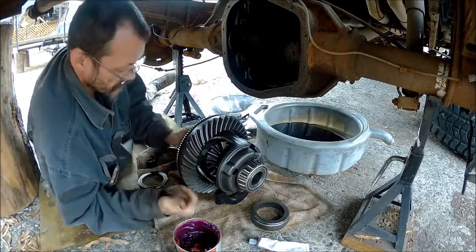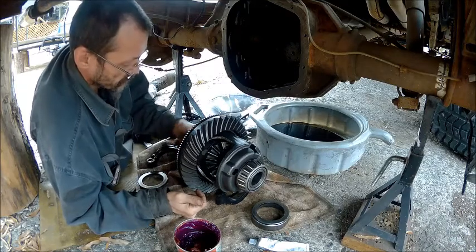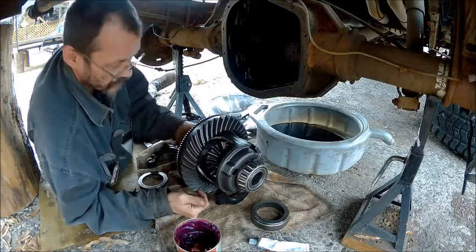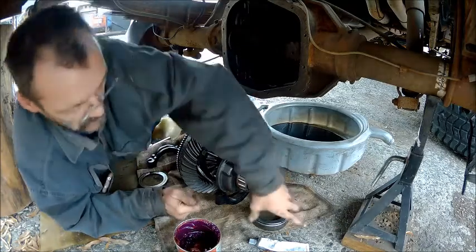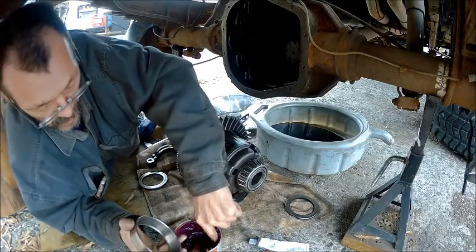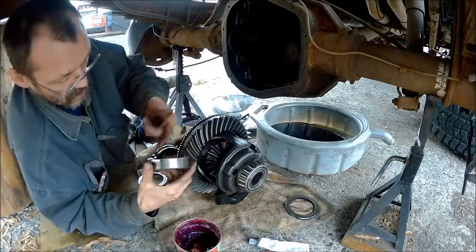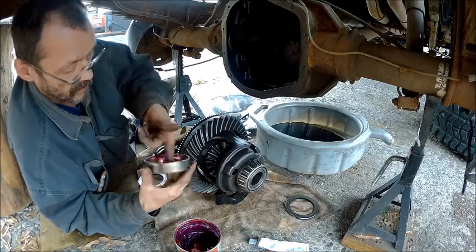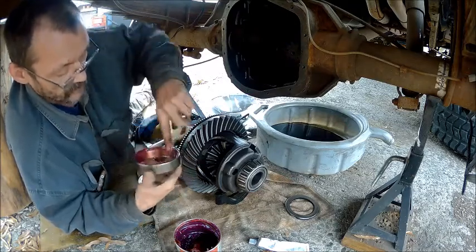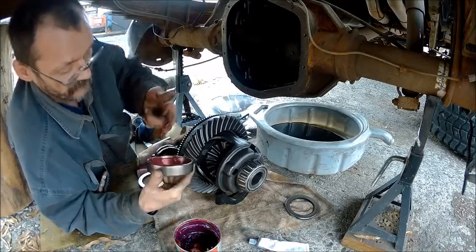The reason I'm doing this is to give the bearing a kickstart before the gear oil starts working. Then I'm just going to turn them a little bit, kind of get some of that into the bearing on each side. It also helps hold the race on the bearing while you put it in — but at least that's the consensus.